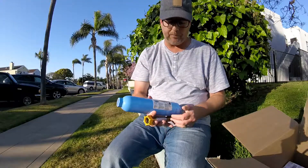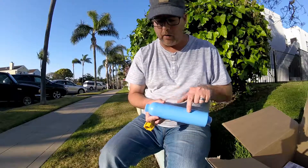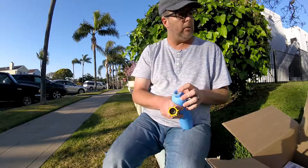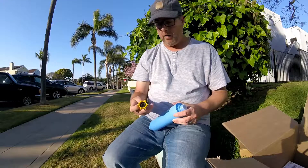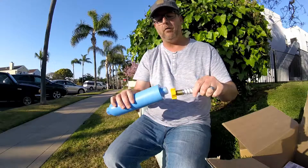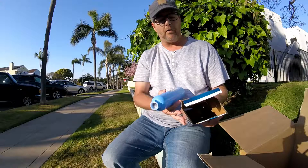This one's kind of required but not a must-have — it's a water filter. There's an arrow on here that shows the direction of flow. It's the same garden hose fitting style. What you'll do is put the pressure regulator at the city water spigot, run your hose all the way to just before the RV, then connect the filter right before the RV. This gives you a little flexibility at the RV connection so if you bump it walking around you're not breaking something. The box says this filter handles bad taste, odors, sediments, bacteria, chlorine, and much more.